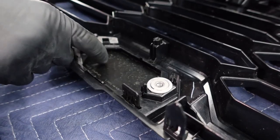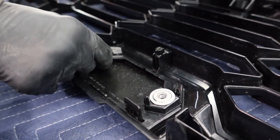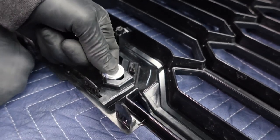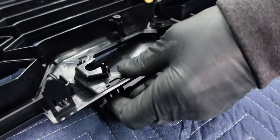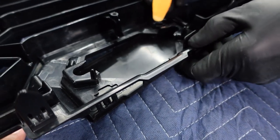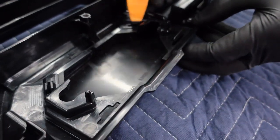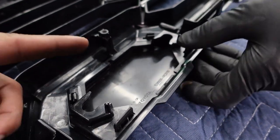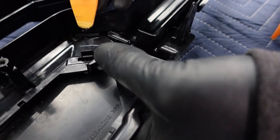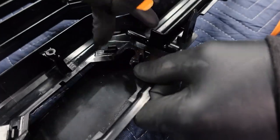Easy peasy. To transition to the other grill, you're going to need these screw washer nuts that slide right in — take those with you as well. To remove the radar's front cover, you're going to see four clips: one there, one there, and on this backside one here and one over there as well. A little tip: use the trim tool, press it in between the two clips, and then push down hard. There it goes.